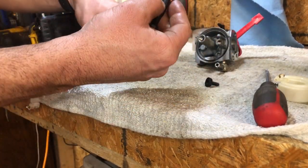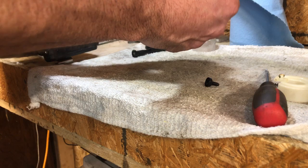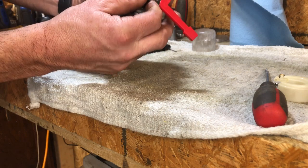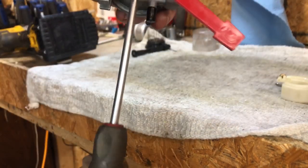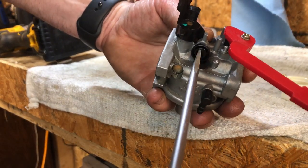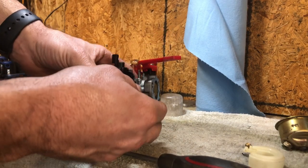I'm going to reassemble everything. Our tiny drill bit — I literally set it down and lost it. It's that small of a drill bit. Put it back in there. I just want to bring the idle screw through until you've got a decent little nub. At about that point we're making contact, and from there we'll do a full turn.